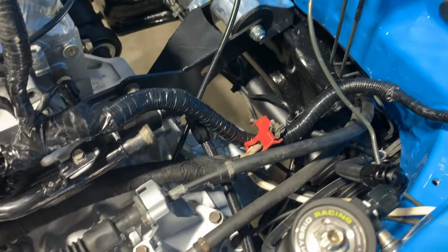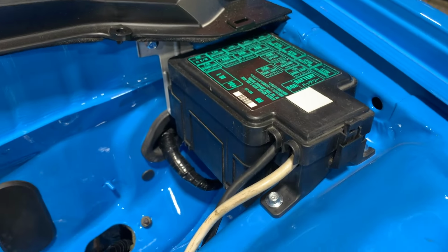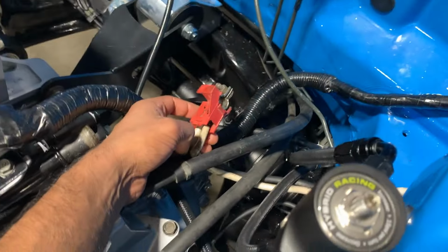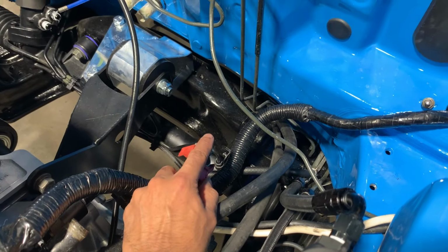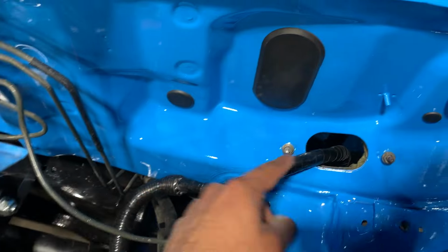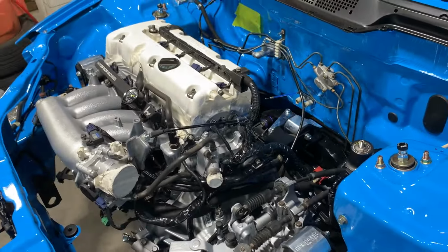Now with the charge harness, exact same thing. This is the battery connector for the CL7. We've got the two wires put into the fuse box, factory location, as you can see. We'll be removing this and putting a 2-to-1 connector, and then having that one fitting and the wire run through the same location into the tunnel here. And that's pretty much all the wiring done.